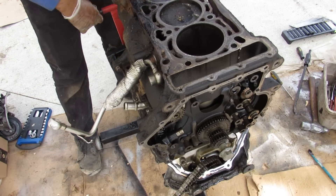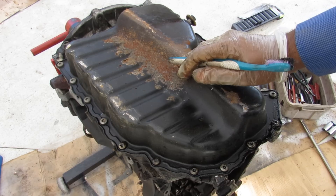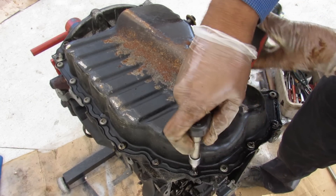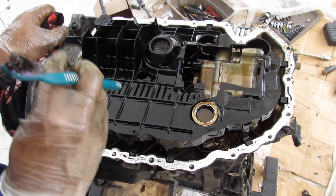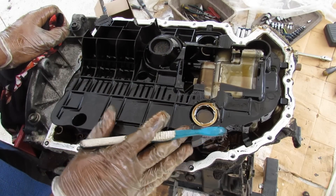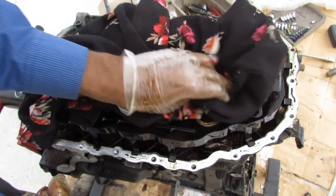I'm going to flip this engine over to access it from the bottom. Of course this causes a big oil leak, so I'll use a cloth to clean that up. The lower oil pan is stamped steel, so I'll remove all the T30 bolts around it and pop it off for a look inside. Right away we can see a plastic oil baffle and the oil pump. The oil pickup tube is nice and clean with no sludge, and there's plenty of oil everywhere, so this engine wasn't starved for oil and didn't have a sludge issue.